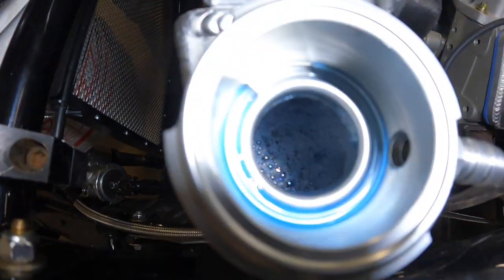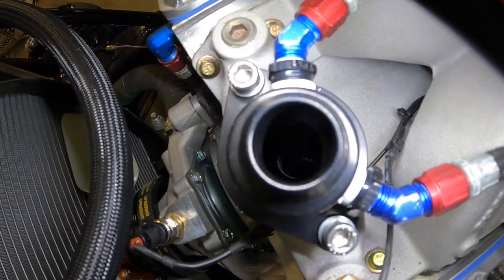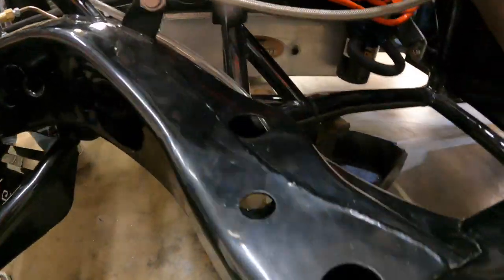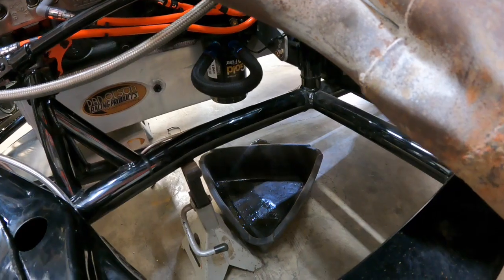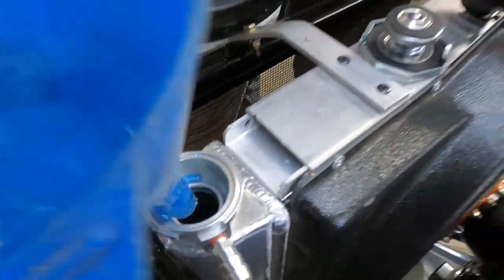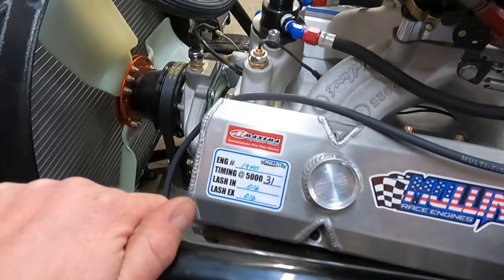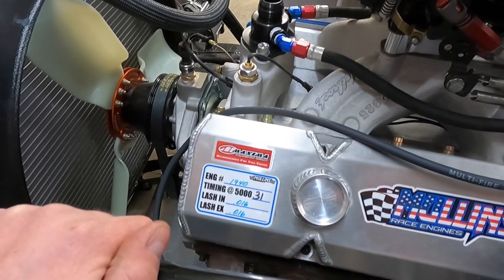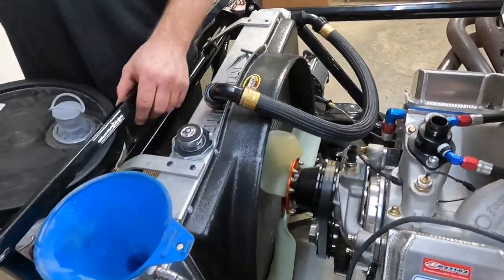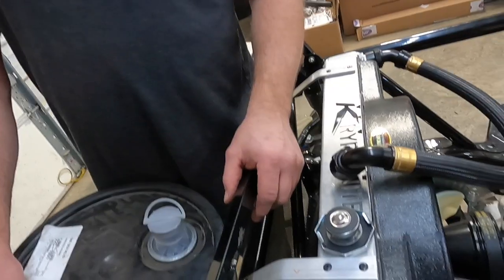That's really hard for them to see. Anyway, a little in there. See if we can see in here. A little in there. No leaks to speak of yet, other than that leak on the other side of that drain pan. That's kind of like where we like to run it, a couple inches down. Ain't much, if you think that's higher than that, wouldn't you say? So maybe you want to pour just a little bit more in it. Well, that, or once you run it, we'll check it. Yeah, it shouldn't have an air pocket in it now. I don't think so.